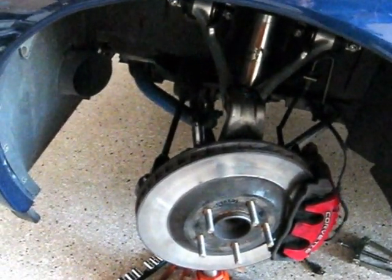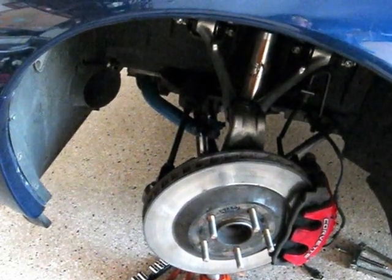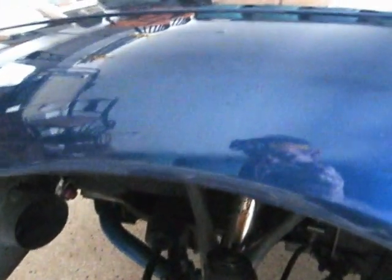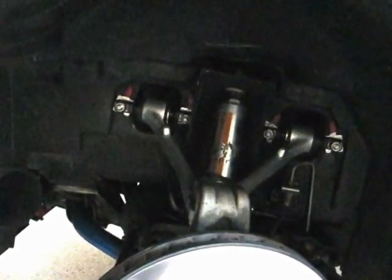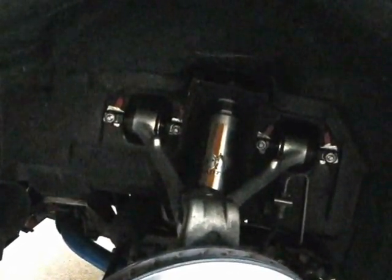Instead of doing the lower — because the lower is a different bunch of sizes of tools and requires laying underneath, and I'll have to jack the car up maybe a little bit higher — I'm going to leave that for another day. I did just get off the phone with FOT technical support, and I talked to them about my concern about how tight the poly bushings are when I try to turn them by hand. He said that's how they're supposed to be, and that it's really trivial the amount of torque you can put on with your hands compared to what the suspension actually undergoes driving on a racetrack. That's good enough for me — they're the experts and I've never been steered wrong by FOT. So I'm just greasing them up, putting them back in, and going for another year. Froggy out.